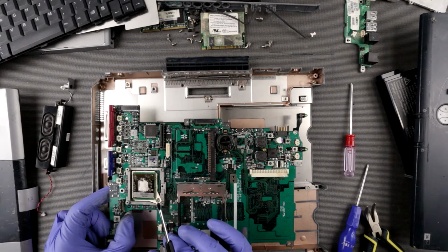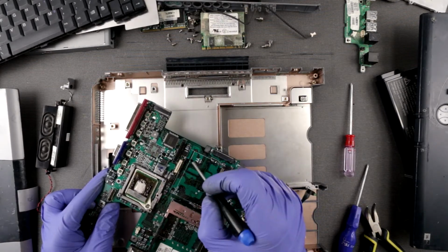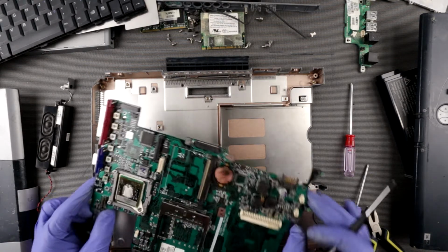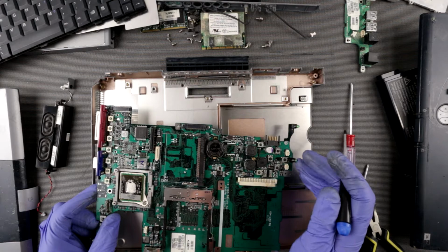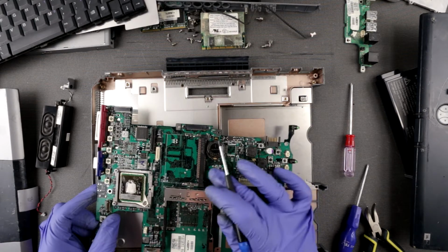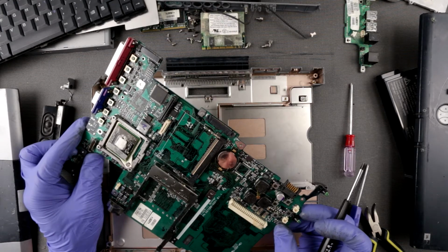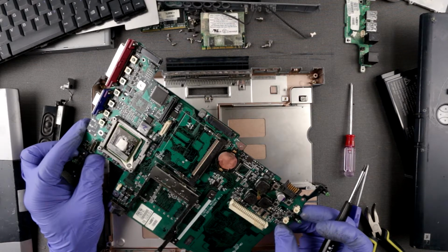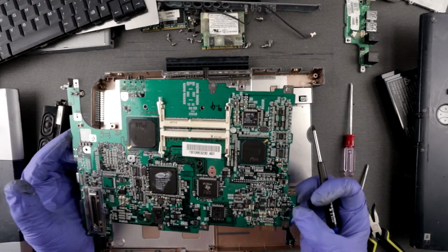I'm not sure if this is a MOSFET or a voltage regulator of a sort, but there are a few of them here. Yeah, it's probably a MOSFET. Yeah, this guy and this guy the same. That's it. This is another voltage regulation circuit over here. I don't see any power elements though, it's only a few inductors. What is this guy? Something from TI. PU2211 means nothing, unfortunately. I just don't see any beefy transistors here for the power, unless it's all on this side.